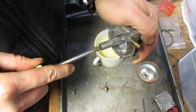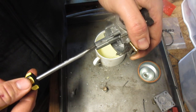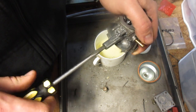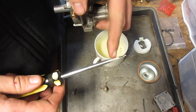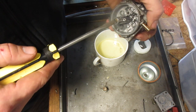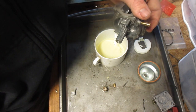What's going on? Okay, good. So, word of advice. Go to your discount aisle of your hardware store. Go to Amazon. Find a screwdriver that's cheap, whatever. Just find a cheap screwdriver and grind down the ends. Because they have these little flutes on the side and it's too wide, so I just kind of make it flat. And then most of these carburetors are all the same, like jet size, I want to say. Like the slot in them is basically all the same. So if you can get one fitting good, it will work for like 80%, and the others you'll have to work on.